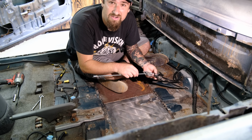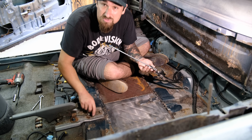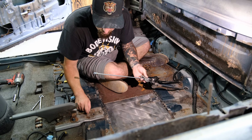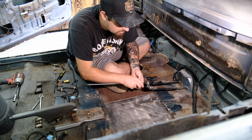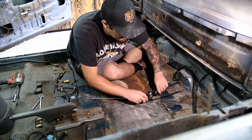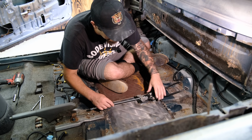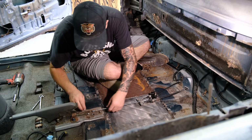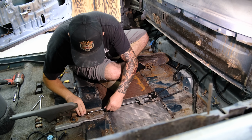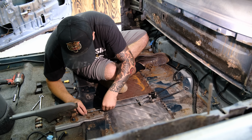So what we have right here is the cable, and this mechanism is threaded. This threaded mechanism used to go in this guy right here, which is also threaded. So we have an M6x1 all thread, which matches the thread right here. So what I ended up doing is I just welded in this little piece of plate steel. So that's going to go right there. This is our extension piece. This extension piece is roughly the length that we extended everything by, and this is also adjustable. So we need to get this guy to screw into that guy right there, just like that.